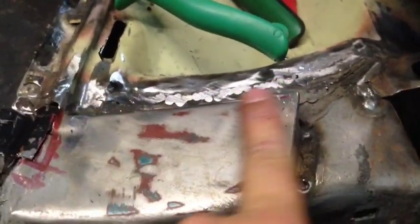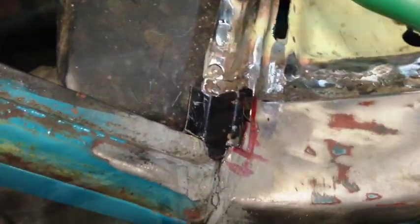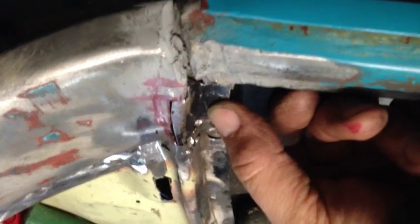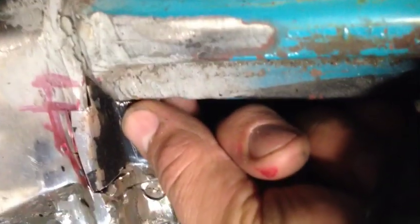Another thing - when I went to put this panel back on it sat a little bit high, it wasn't level. So I just got the hammer and banged about here where it was a little bit high, and now it sits flush perfectly. I'm going to try and bend this a bit. I got this little piece that fits perfectly in that gap, I've got the right shape to it, so I'm going to weld that in. For this whole corner I'm not going to put bog in it - I might just put lead in it like they used to in the old days. Still debating, but it looks like that's ready to weld in.